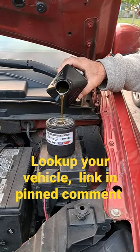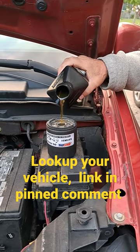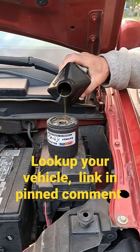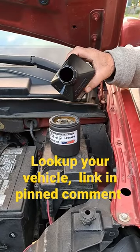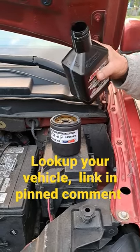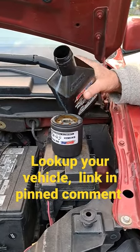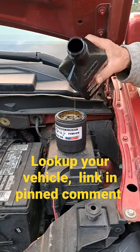To pre-fill or not to pre-fill — that is the question. I know this is controversial, but with Amsoil you don't have to worry, because this stuff is filtered to 98.7% absolute at two microns before it's bottled. So even though that oil that you're pouring in the center goes straight to your bearings, you can be assured that it's clean.